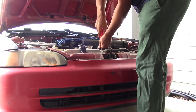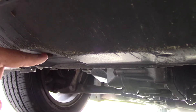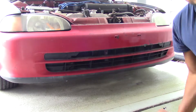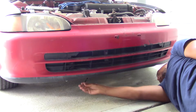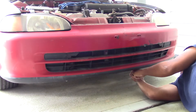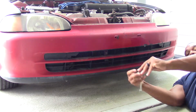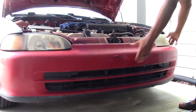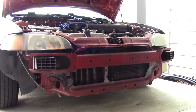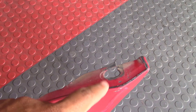Here I'm showing the removal of the top screws and bracket plate — these are removed with a Phillips head screwdriver. Here's the location of the two 10 millimeter bolts on the bottom of your bumper. After removal of those bolts, my bumper slides right off. I don't have the two headlight mounting bolt locations on this bumper since it's been through a lot over these 20-something years, but you may have yours, so make sure to double check and remove those bolts as well.